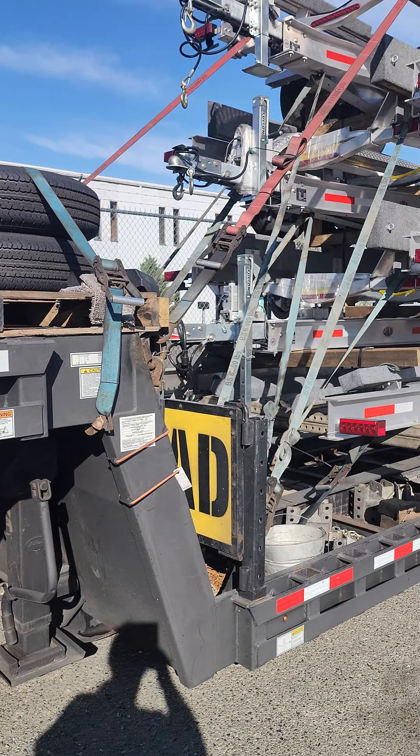If you haven't watched my first video, you'll see that we do not strap the same way that we strap boats. With boats, the back of the boat — we put the straps going forward down to the trailer. Here, can't do that because of all these fenders and everything. You can see where the straps would be trying to come down, it just won't work. So you hook your clip right up in there, put some carpet, and then that strap is going to come all the way down to your trailer. I always just clip them to the I-beams. I'm not going to show you each individual one because they change each time you get a load with different size trailers.